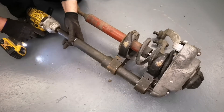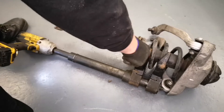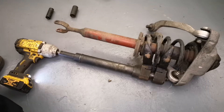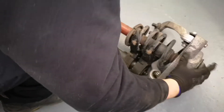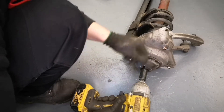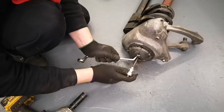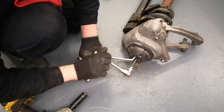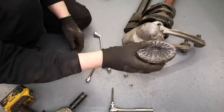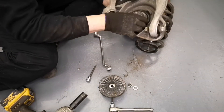That's in quite well — as you can probably see, it's seated really well. You literally wind up till there's no weight on the top, then carefully undo the other end. The strut is spinning — it's got an allen key in the middle of the shock absorber — so I'm just going to wind it out by hand. Now it's off, would I say it's knackered? No I wouldn't, unfortunately. Looks in pretty good condition.